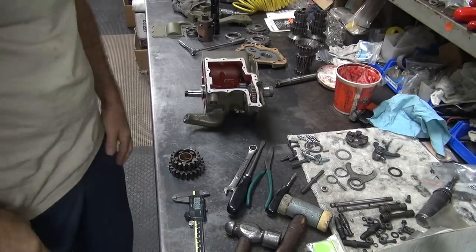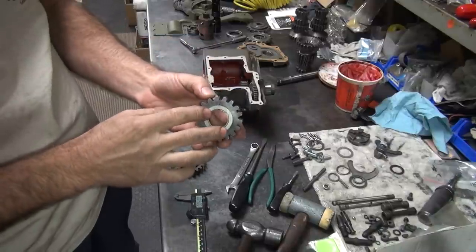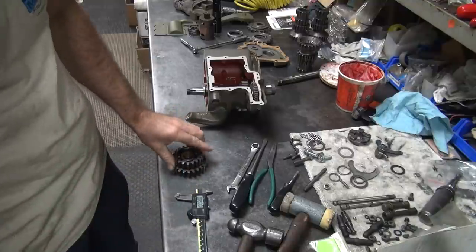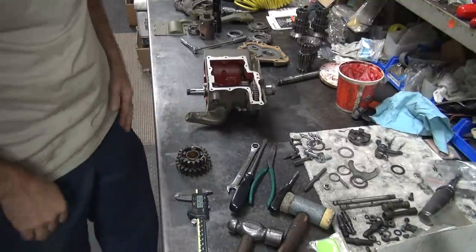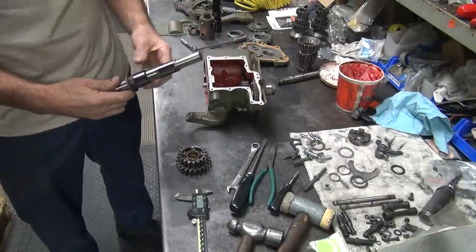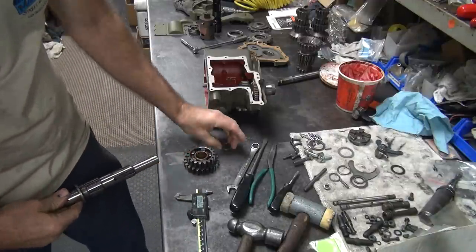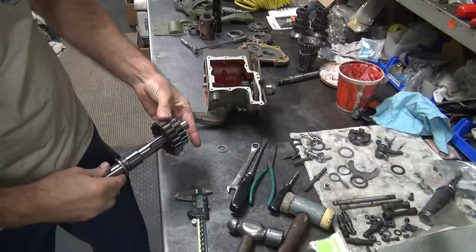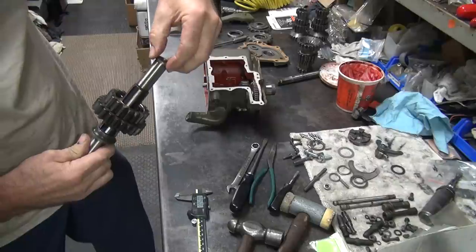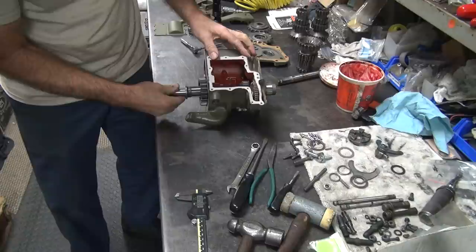Okay, we're back. We have a whole bunch of 2-3 minute videos put together. I put the 45 thou washer in here, which is 17 less than the one we took out. I'm gonna try that. I ground three to four off of here, so that'll give us a number there. So between all of these things, we should at least have something close to working now. Hopefully. We'll find out. That's why we do mock-ups.